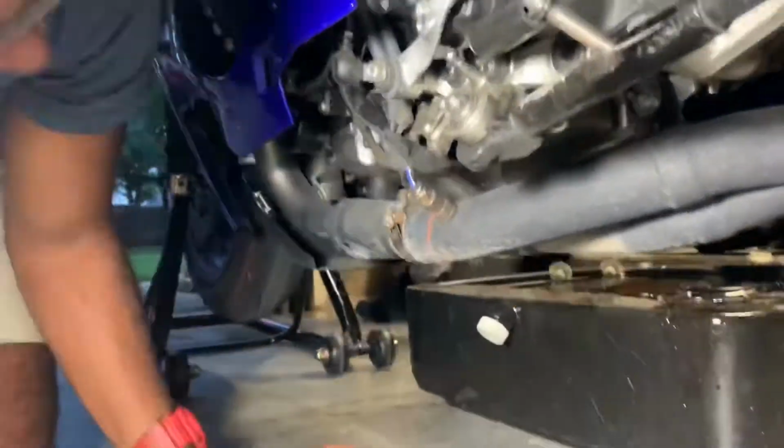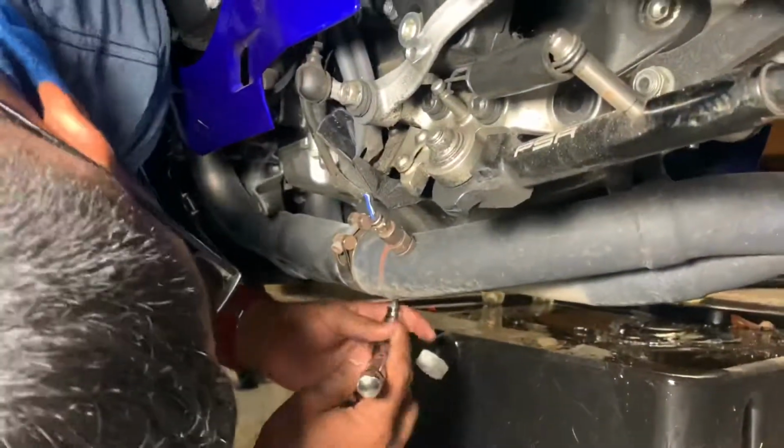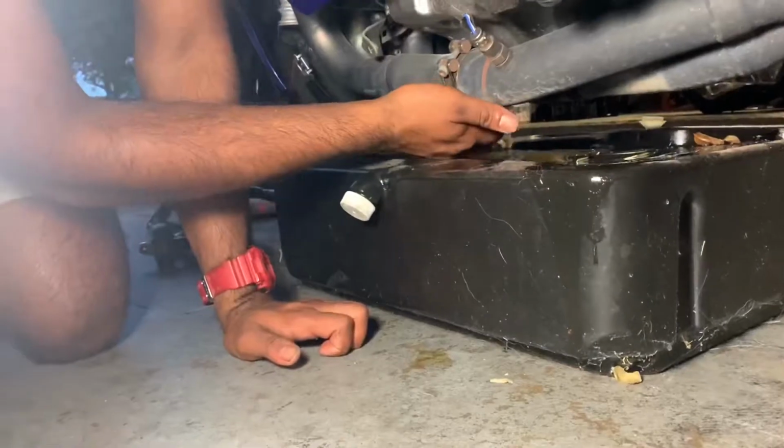Now to remove the oil. The drain plug is going to be on the bottom of the oil pan between the Y pipe. It's going to be a metric 6 Allen key to remove it. I like to use a ratchet for this. I'll crack the plug loose and then slide the oil pan under and fully remove the plug to let her drip.